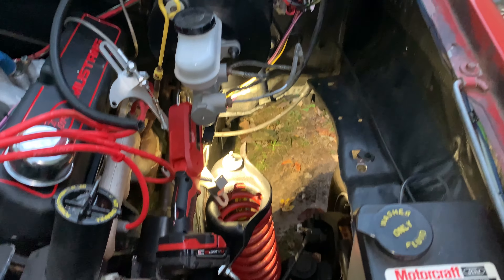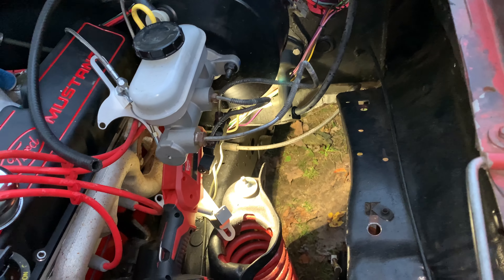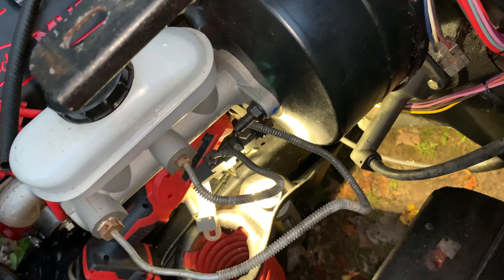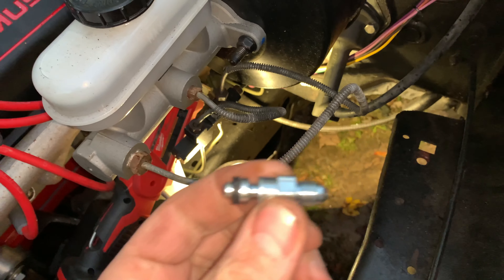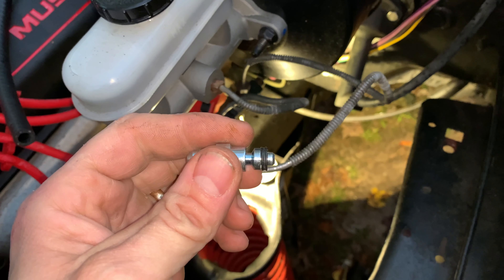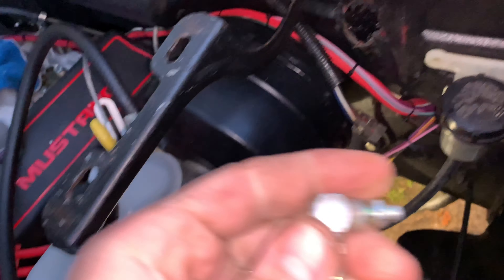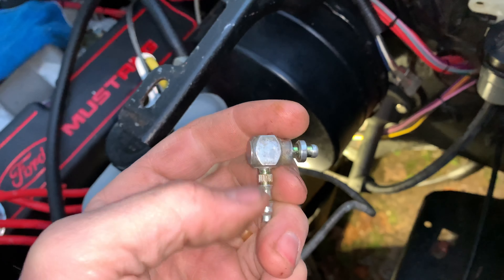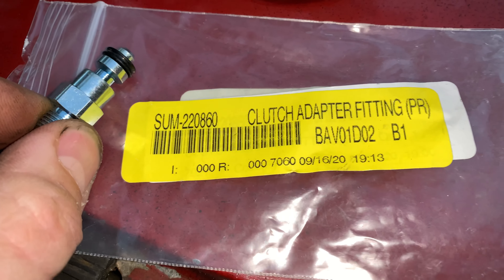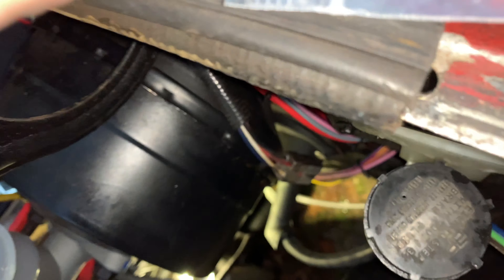The original line from the master to the slave on a Ranger is a thick hard plastic formed line with a weird end that goes into the master. I didn't know how I was gonna get an aftermarket line, so I went on Summit Racing and they actually make and sell it. It's that weird fitting that you just push into the master, a roll pin holds it in, and then it's a dash-3 fitting. That's the original fitting — it had the hard plastic line on it that you couldn't do anything with. They sell it as a pair; I think it was like 15 dollars from Summit.